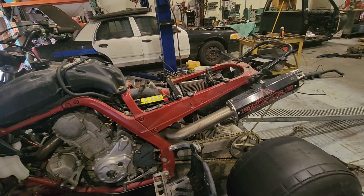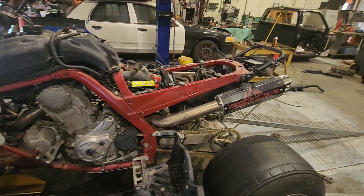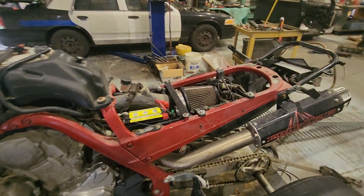So what else I did is I drained most of the 93 out, dumped MR12 in, and added a half a point of fuel to the yellow and one point of fuel to the red. In math conversions that's probably about 3% extra fuel at wide open throttle pulse width and maybe 1% in the yellow mode or acceleration side. Same ECU flash as what it was set up for with the other gas, but now when we made a change we can make the change in the tuner — that's the big benefit with the tuner-flash combo. You can do some on-the-fly adjustment. It's like having an electronic carburetor — you can just change a jet real quick, 165 to a 167, and try it with a click of a button. But all the good math is done inside the ECU.